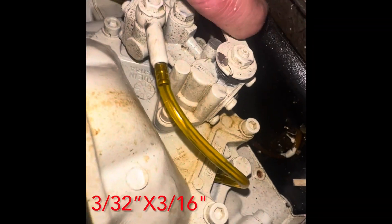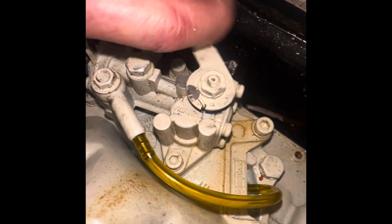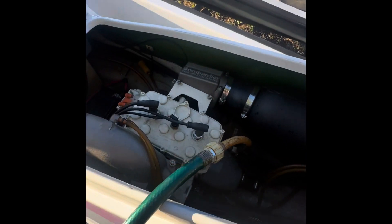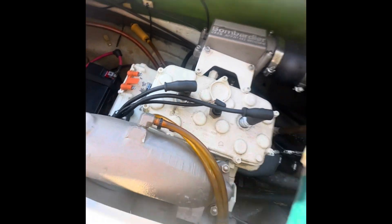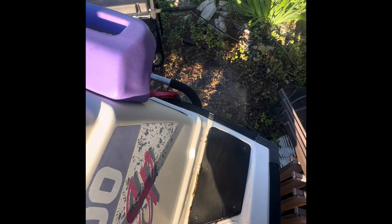This little guy is the throttle for your oil pump. While the Sea-Doo is idling, just hold it wide open and it should prime your system. You can actually watch the oil travel through the new lines you just put on — it tricks the system into thinking you're going wide open, so it's trying to feed a lot of oil in. Anyway, hope this video helped you — good luck with your project.